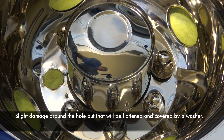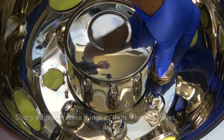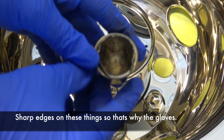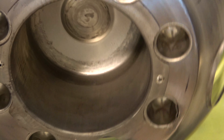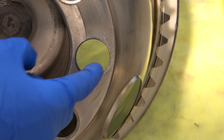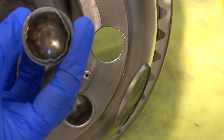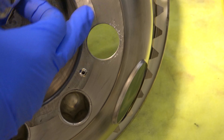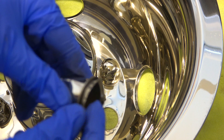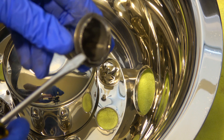Anybody that's got a vehicle with these wheel simulators on it is aware of some of the potential problems. Usually there's two kinds. You got the kind with the snap ring on the back — you pound it on there with a rubber mallet — or you have the kind that does not have a snap ring on the back, like this one, that lines up with two of your studs. You put stud extenders on there, position it, slide it on, and it's held on with real lug nuts.